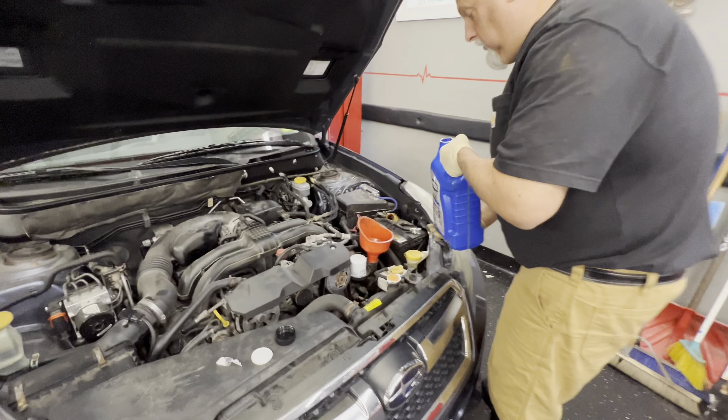Like any other oil change, guys — you may do one or two on your car a year. You want to check all your fluid levels at this point, your belt condition, your battery condition, make sure your terminals are clean. Give this thing a good look over to make sure it's safe until your next oil change. Check the tire pressures, squeaky door, check your wipers, check your lights — all that stuff. It's only going to take an extra five to seven minutes.